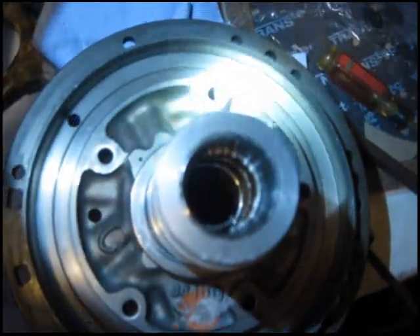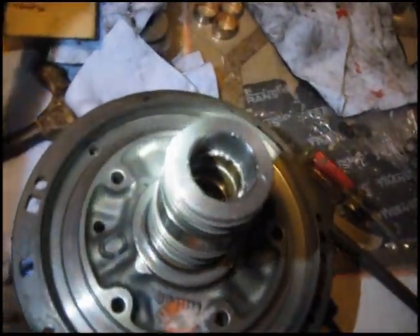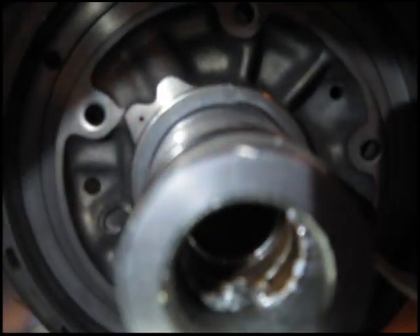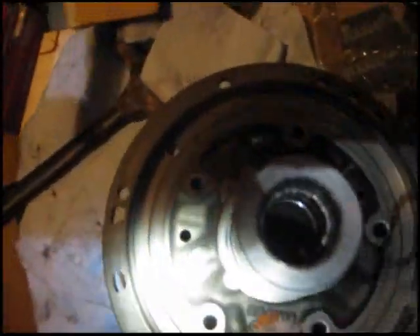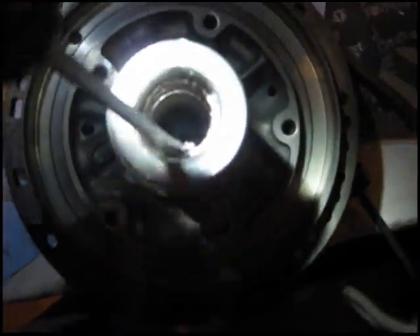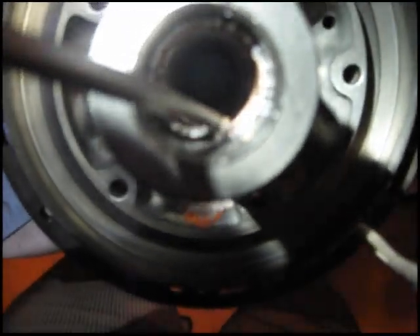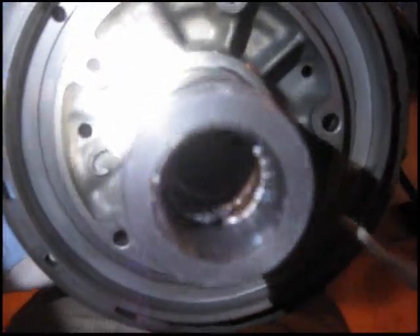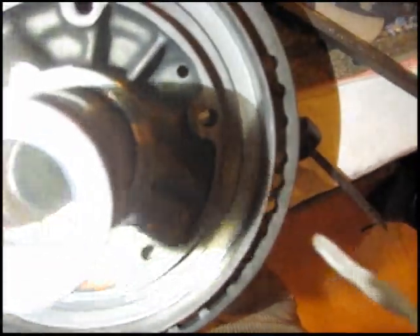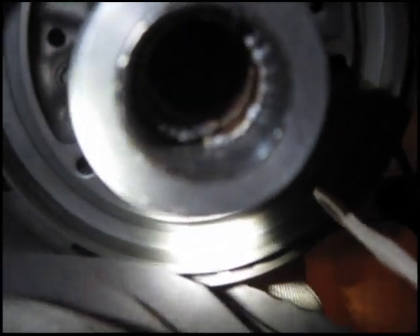The two bushings on top of the pump - I hammered them down and got it to split. Using this big chisel, then took a small screwdriver and pried behind it, and it popped loose at the seam where the bushing is made. If you can hammer with a chisel and screwdriver without scarring up the sides, you'll be doing good. If you can do it right where the seam is, you'll be doing even better, because it popped loose right there at the seam.